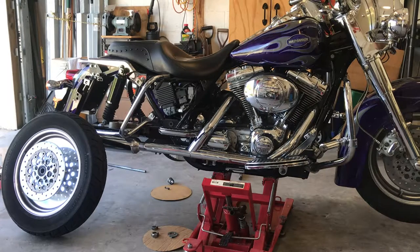Now with that, we got the tire is off, removed. And that wasn't that bad, one person. So now, as you notice, that little half inch replacement axle that I threaded in there gives you just the right wiggle room to move this around without bending your rotor or scratching your rim. With that, we'll have a new tire put on and then we will reinstall.